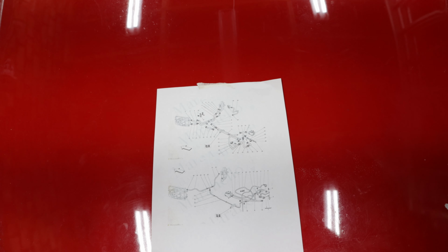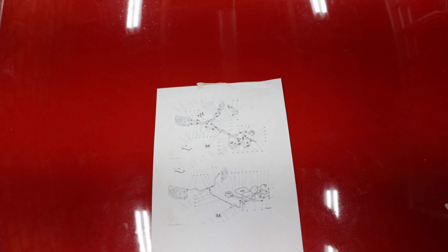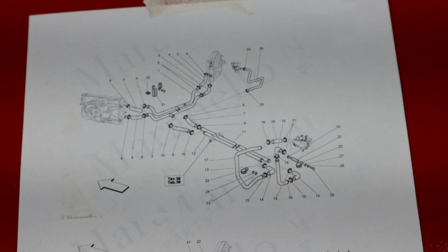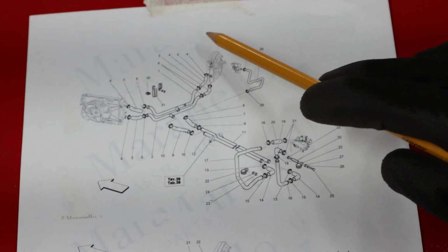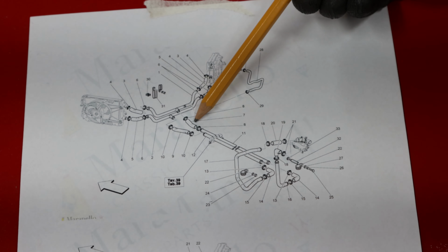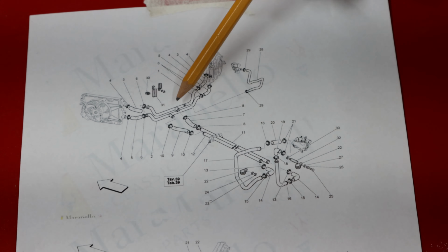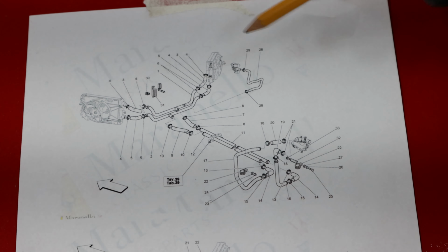So what we have in front of us is the two main diagrams for the coolant system. The top one is the one that we'll go through first, and that's basically the main diagram. So what we have here at the front is the two radiators, so those sit under the front bumper. There's pipe work connecting the two together, and then underneath the car there's an inflow and an outflow pipe. So those are the big aluminium pipes that we took out when we got the car off of the jig, so those will need to go back in.